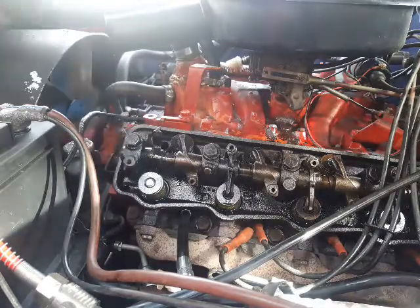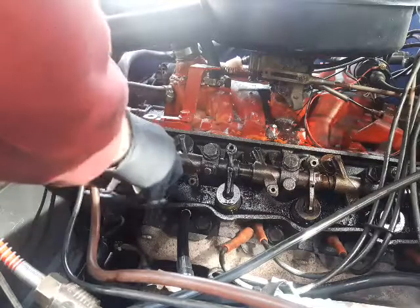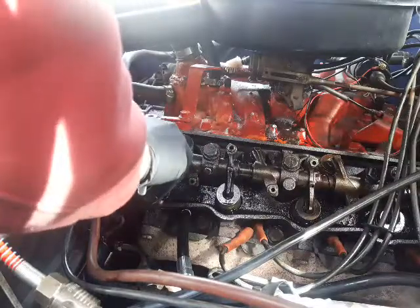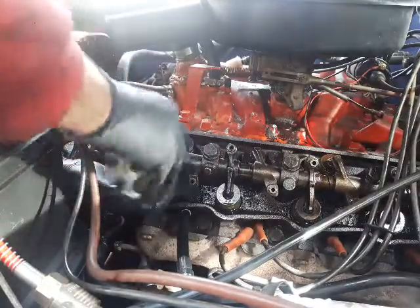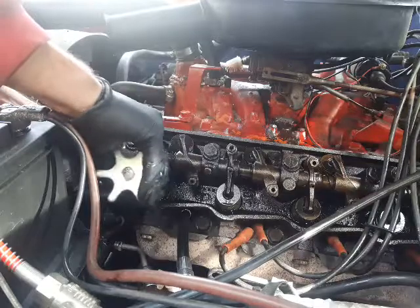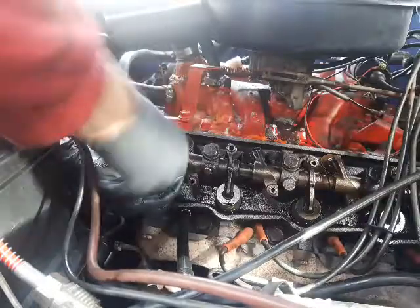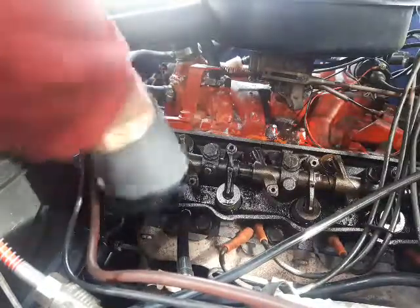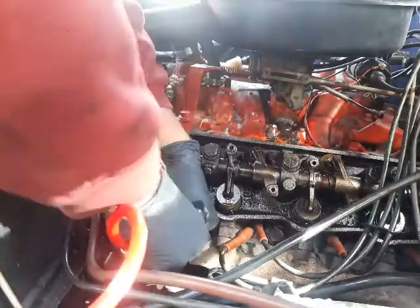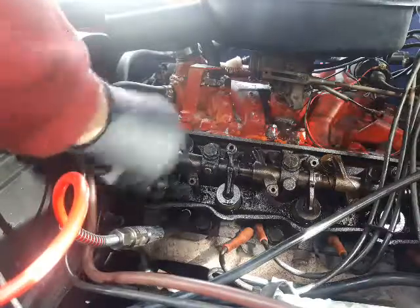You see? So now next steps are like all others: getting the spring compressor, put it over it, find a good position so that it's not slipping away. Here I can take even one more, so then turn it, and when I start feeling the spring gets compressed and I have some play in the valve, it's time to connect the compressed air. So now I can be secured that the valve is not falling in.